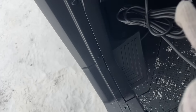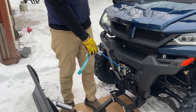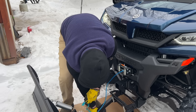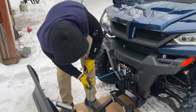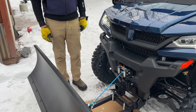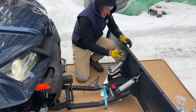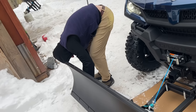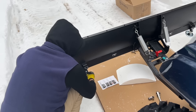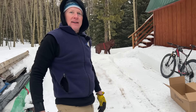Here is the control for the winch — we plug it in, let the cable out, and connect it to the plow. You want to be careful not to go too far. The last part is putting on the little skid shoes — that's the easiest thing I'm doing all day. And now it's ready to ride!